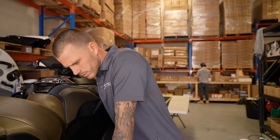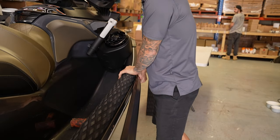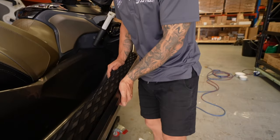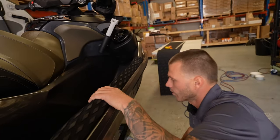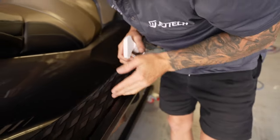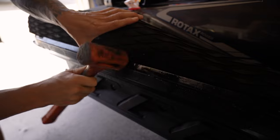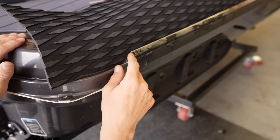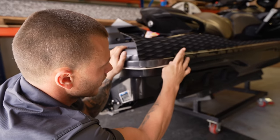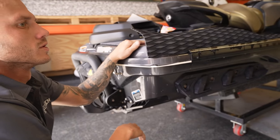Before I continue, I'm going to put this bumper strip back on because it's kind of in my way — feed it back on that way. I actually use a rubber mallet. The finish of the hull was a little bit tricky there, so I've got out some soapy water and I'm tucking it under here and then applying it back over. You don't want to get the turf too wet because it hasn't settled yet, but just a little bit of soapy water on it. Tuck it under first and use soapy water, then tap it over on the top part. Don't use a proper hammer because you'll damage your hull — use a rubber mallet. I strongly suggest that, or a strong fist if you've got one.